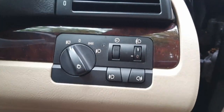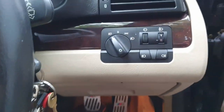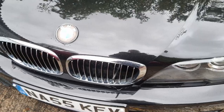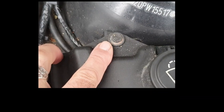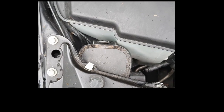Pop the bonnet — all you're going to need is a long screwdriver. First off you're going to need to remove these two covers. On the other side you're going to have to remove your water tank, which is just a 10mm socket — take that out and this just lifts out. Then I'll show you where the switch is.